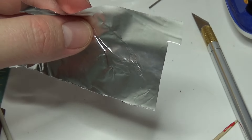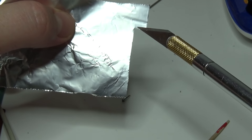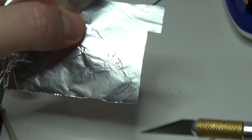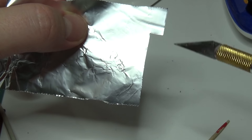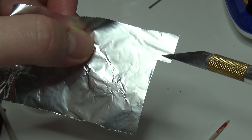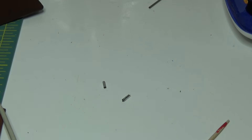When you're cutting the piece, you don't want to make it too long. The width of the piece is the full length that it'll slide into the headlight — you don't want it any longer or it could get mashed inside the shell and block the light, and you don't want any hanging out the other side. So cut it just a little bit shorter than the length of the housing. Lengthwise, you don't want to make more than just a little over one roll — it gets too thick and too hard to handle.